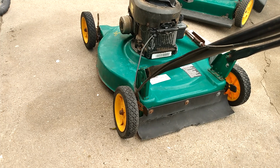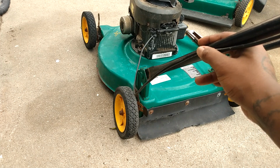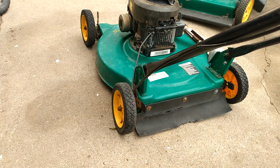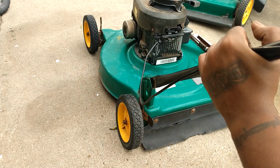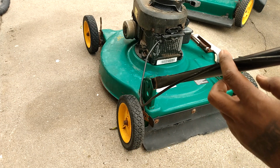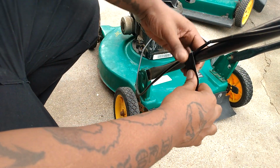See how the rope is flexing, jumping right in this area. So what that basically means is this is a stress point. It needs to become an anchor point. It needs to be secured down to transfer the stress or the tension of the wire down to release the brake. Easiest way to figure it out is once you put your vice grips on or got your top half secured and anchored, grab it where you see it flexing. And you see how it's moving now. So that's a good spot. Easiest way that I found is a combination of zip ties and electrical tape. But this is a cheap flip, so we're just gonna do a good old tape.